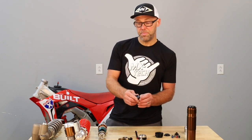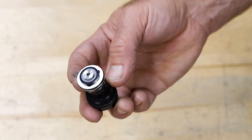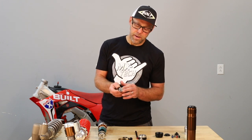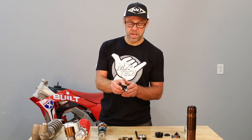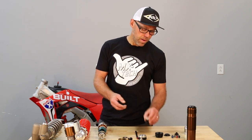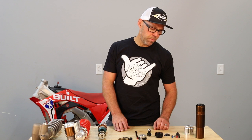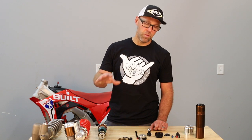Talking a little more about the adjusters: in your compression adjuster, we have what we call our MX Tech 3-Way, which includes a low-speed, mid-speed, low-speed rebound, and also an integrated high-speed circuit. The compression adjuster has a main compression stack, a sub-valve stack, and a return circuit for the low-speed rebound. When we go over to the high-speed adjuster, we have a series of cones with different tapers and shapes, along with a combination of three different springs we can select from to optimize tuning for the specific bike.